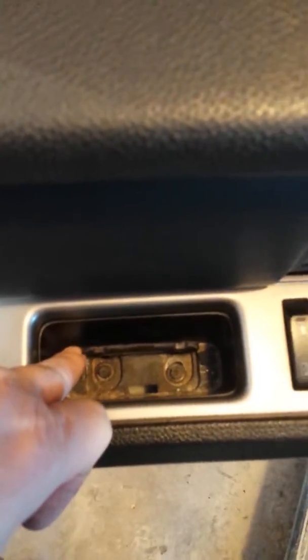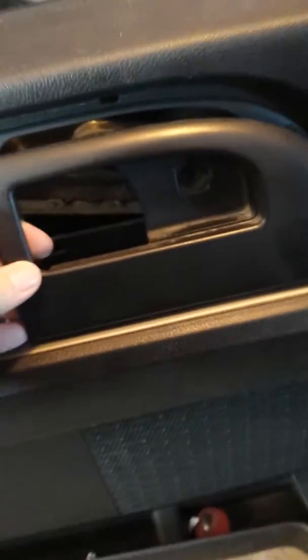In the handle there are two seven-millimeter bolts and one seven-millimeter bolt, then this plastic piece comes out of the door on the bottom down here. There are two seven-millimeters — they're wide open, easy to see — and on the end right here there's a Phillips screw.